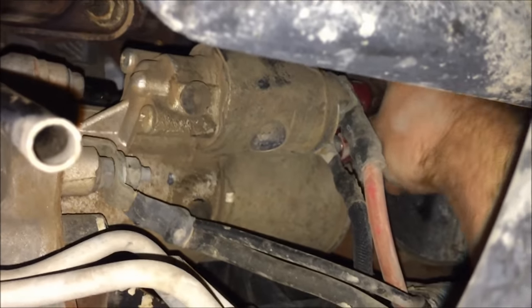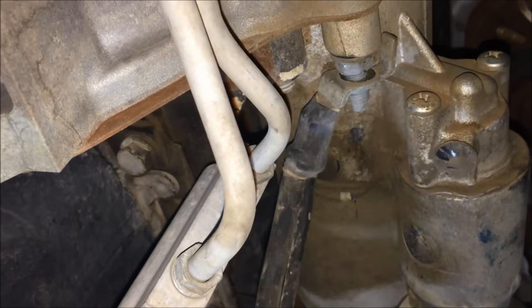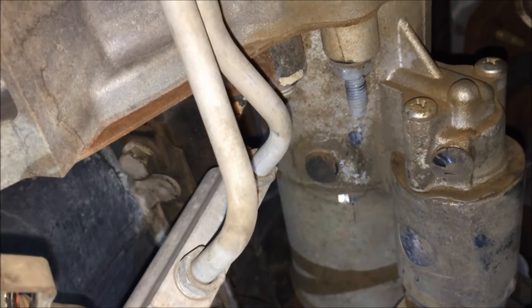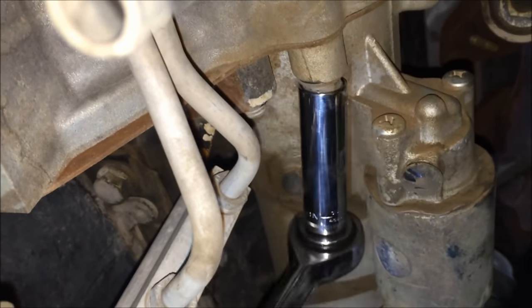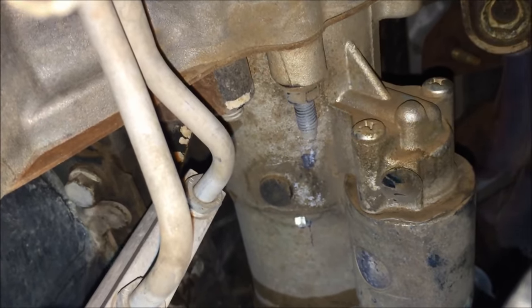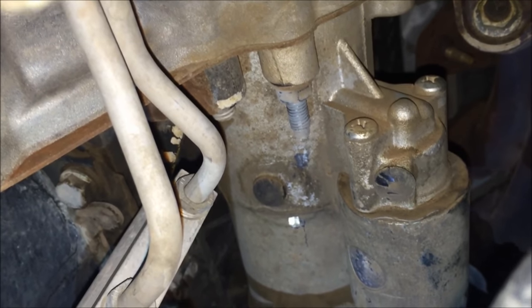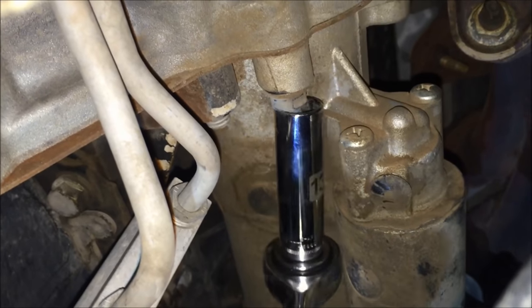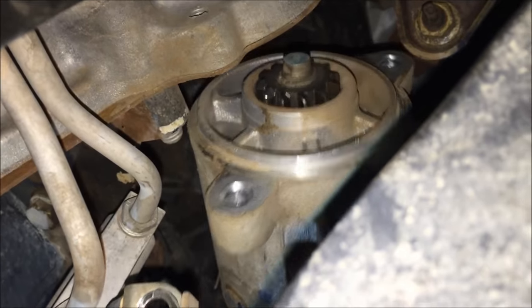You have to use that approach in order to get enough clearance with the wrench on that bolt and the one behind it. We took off the 13 millimeter nut right here, then you can remove the ground, and that exposes another 13 millimeter nut on a stud — so you have to use a deep socket to get to this one. We already went up in with the really long extension and got the two bolts in the back. With that last third bolt out of the way you can just pull the starter away and set it down where it's supported.